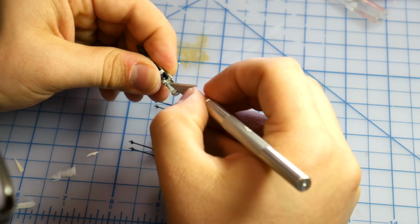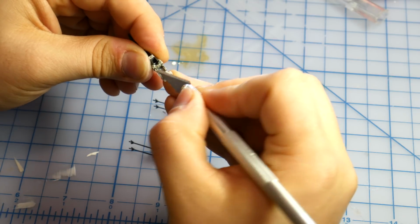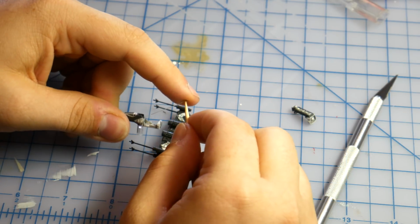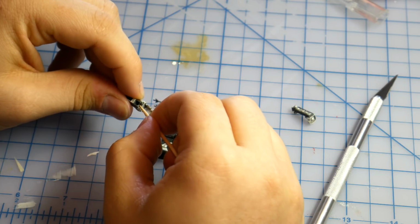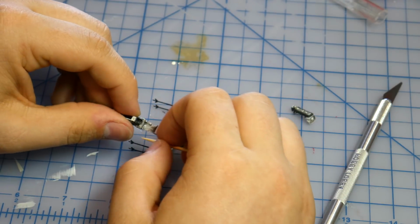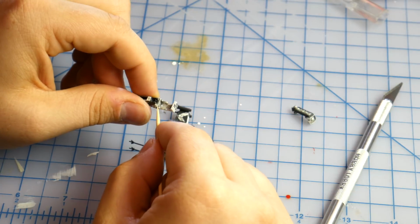There is still a significant amount of glue remaining in the model cavity. I find that the toothpick and the screwdriver, combined with the X-Acto knife, work together well to remove all of the glue. Be sure to scrape everything out of the deeper cavity behind the cockpit. There is a lot of glue down here, and we must remove it to ensure that the piece we removed will fit cleanly when replaced.